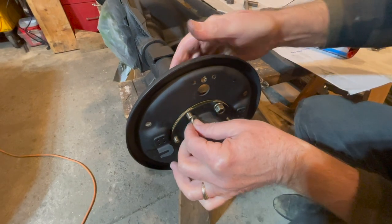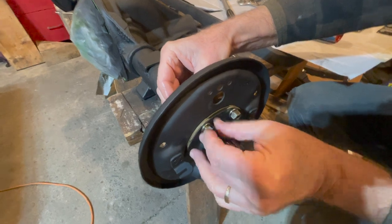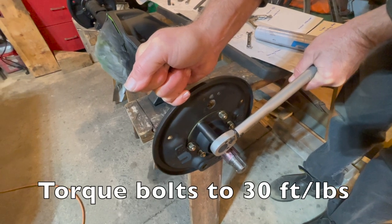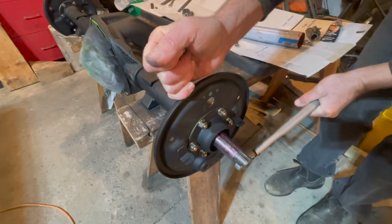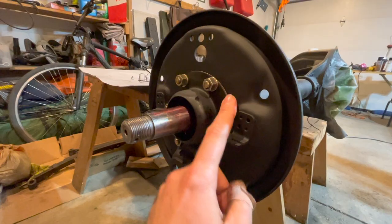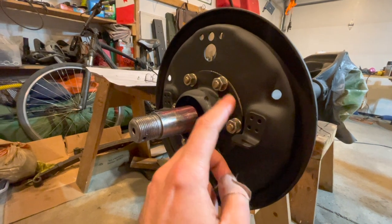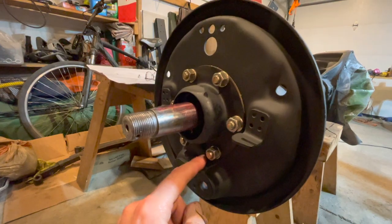The last step is to install the lock washer and fine-thread nut on the bolt. Make sure to torque all 6 bolts to 30 foot-pounds — use a torque wrench and a wrench to hold in the back. We'll do it in a star pattern so it puts even pressure onto the gasket maker on the back. The driver side is the exact same steps as just shown on the passenger side in regards to installing your brake backing plate, the gaskets, the oil seal, and your grease retainer. These bolts are torqued to 30 foot-pounds as well.